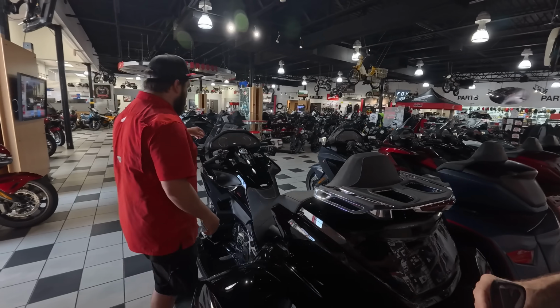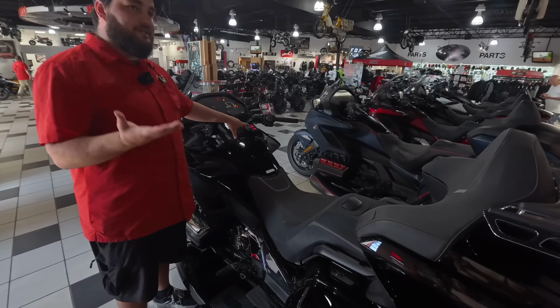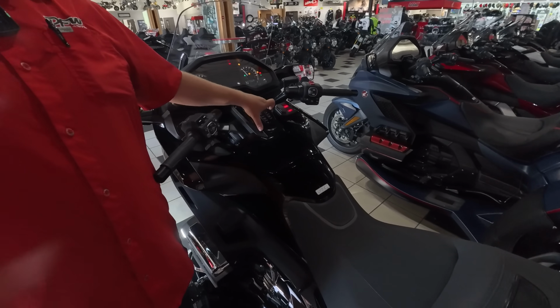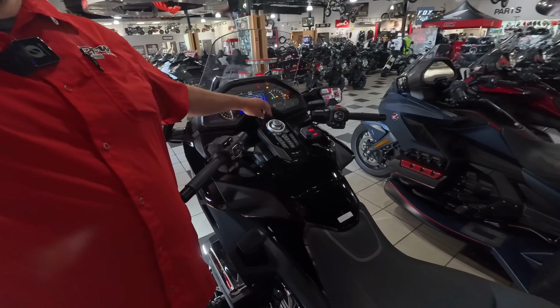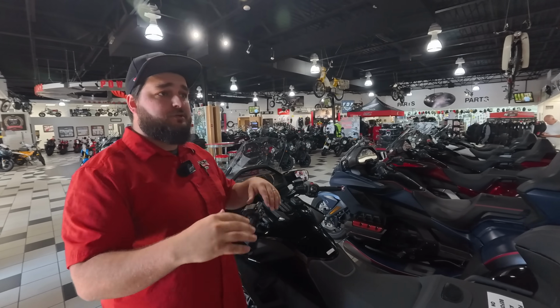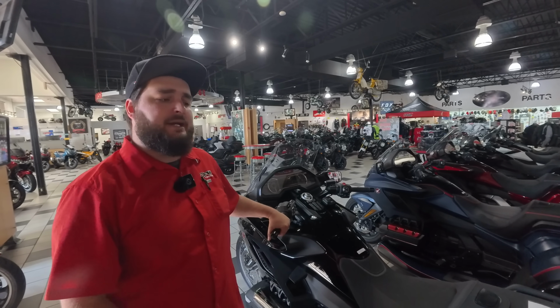Motor Trike's independent rear suspension is actually on an air ride system here. And you can increase accordingly, and you can stretch that kit all the way up to 120, 130 PSI. Now, of course, I don't recommend going that high in the overall. Sure. Standard running pressure, I recommend around 42 to 46. Gives a nice, comfortable, smooth ride.